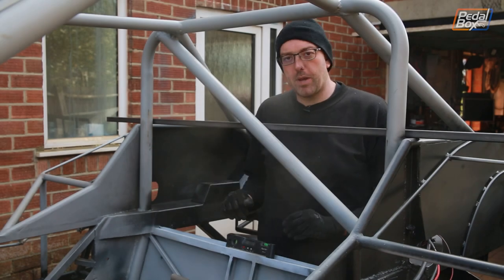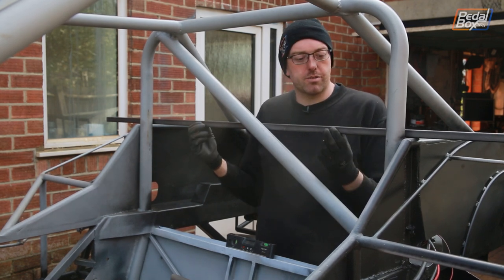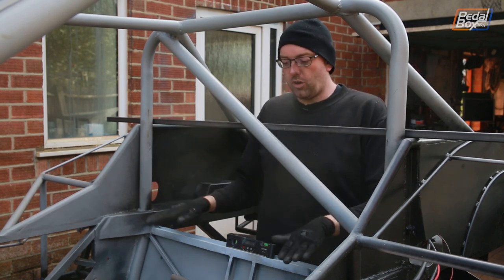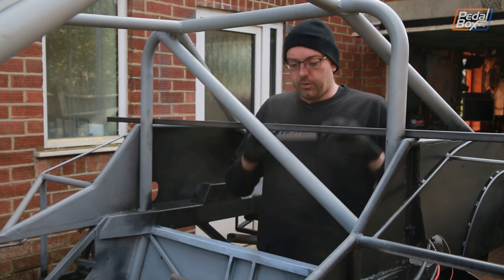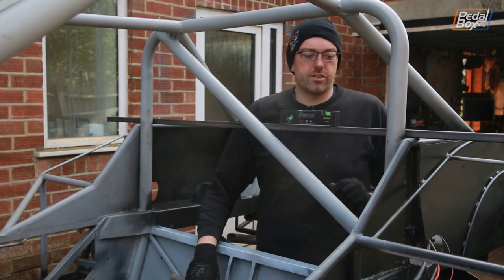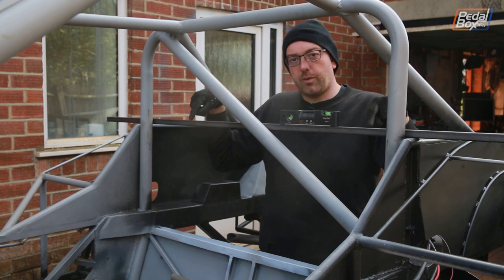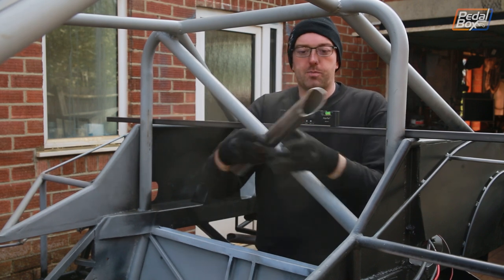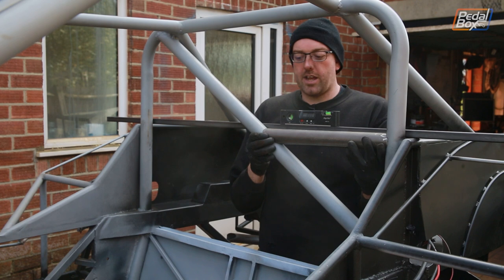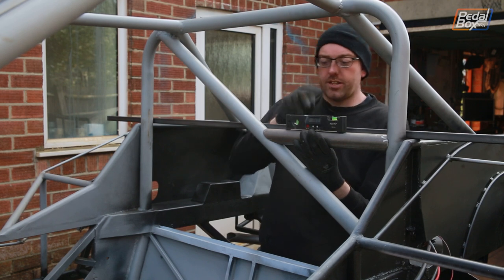While a couple of bits of tunnel are cooling down ready for paint, we can start installing the harness bar. It's completely independent — we've put this beam across the back just as some box section to give us a nice level reference across the car, because we know these two shoulders are in line with the floor so everything should be parallel all the way up. I've checked this on the floor already and set it to an alternate level. Even if the car wobbles side to side, as long as we're in line with this bar we know we're flat. This is the first part I'm going to install — I've already cut it to length when setting up the angles — so we'll just make sure it sits at the same level as the reference bar and weld it in.